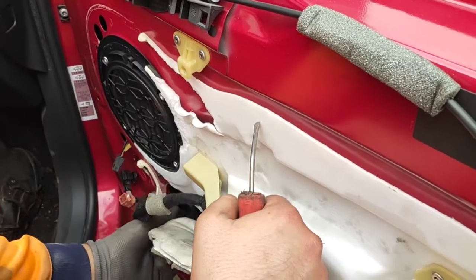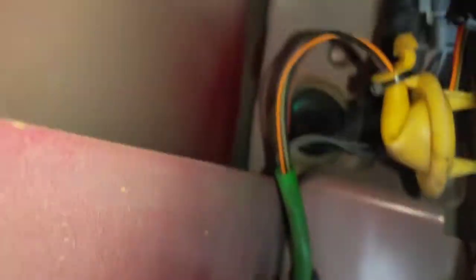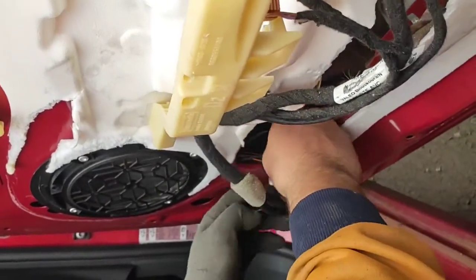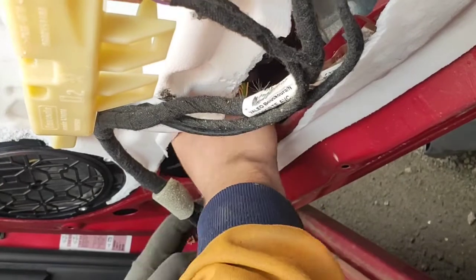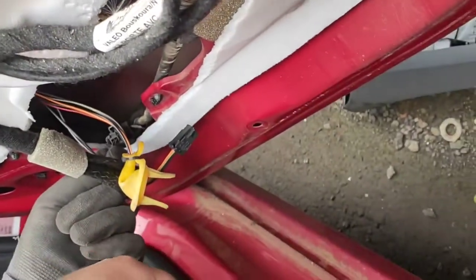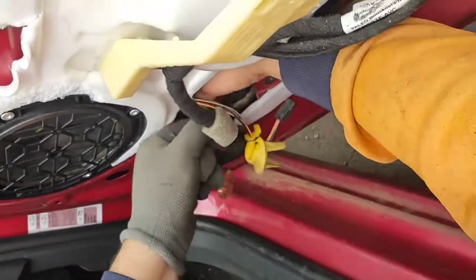Now you need to go behind this white plastic because there is a clip retainer, which you can see right there — it just holds the wire into the door panel and you just pull it out with your hand. As you can see I'm pulling that off just like that. Now the wire is completely disconnected from the door panel itself and we can detach the door mirror. This is why you pretty much need to take off the door trim — because the plugs are there and there's a clip that holds the wire to the door panel on the inside.